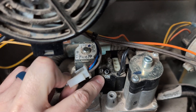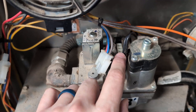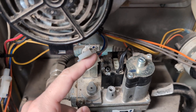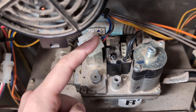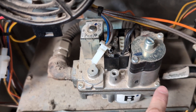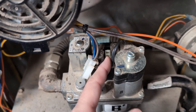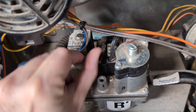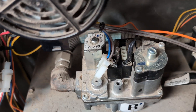So what I want to try is to open up this little black box here. I'm not going to take apart the gas valve itself, but it looks like there are two screws — one in that back corner, one there. I figured that out from looking at pictures online. I'm going to grab my safety bits — these are torx bits with the little pin in there — and try to remove that cover to see what's going on. Incidentally there's an on/off switch here, and I already tried contact cleaner, so I know that's not the problem.